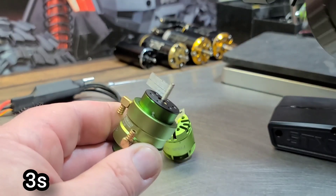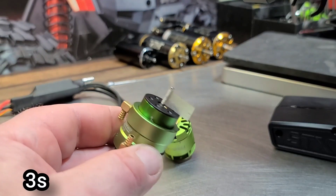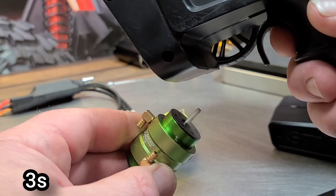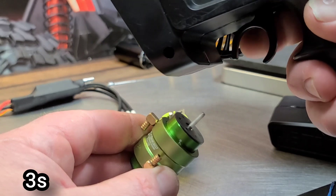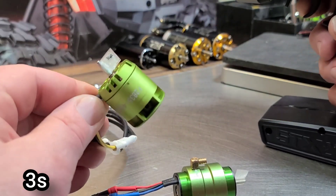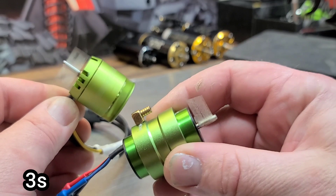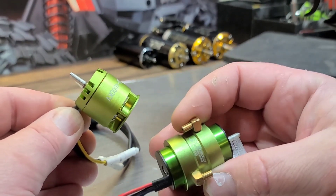Now let's listen to the inrunner. Wow, that's a big difference in sound. This one has like a high-pitched buzz sound, while the outrunner has a low sound. Let's go full throttle right off the bat. It actually sounds like it got up to max RPMs faster than the outrunner. Let's try a linear throttle. The outrunner on linear throttle sounds like it's hitting more RPMs — and it probably is, as it's maxed out on its maximum threshold with 3S.